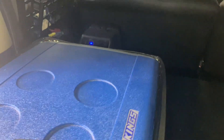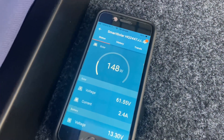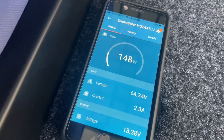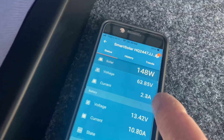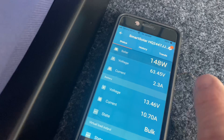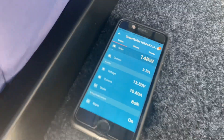Let's get out in the sun. We're out in the sunlight - it's 10:39am and 148 watts off that panel at the moment, it's pumping it in. Current is 10 amps going in from 148 watts - that's about right. It's on bulk charging.